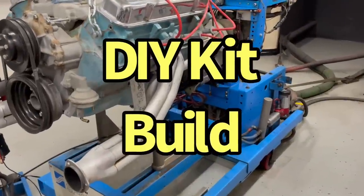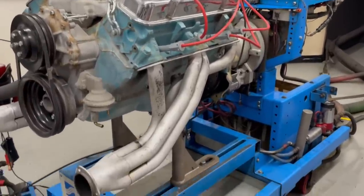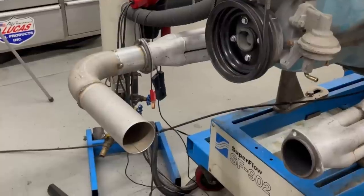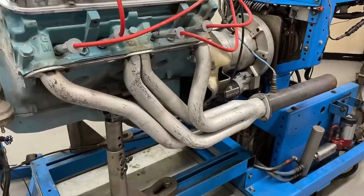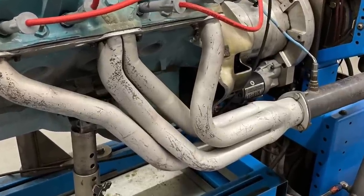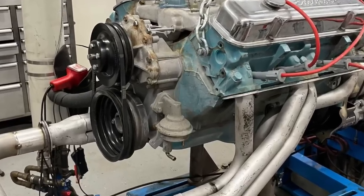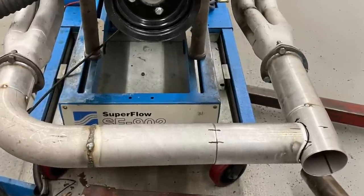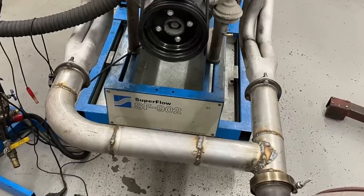Hang on a second — aren't those backwards? Yeah, look what we've got going on over here: turbo kit! DIY. After reversing the headers, we needed to make a Y-pipe. So I grabbed some tubing, three-bolt flanges, turned it 90 degrees, aimed it toward the other side, grabbed the straight section, did a little cutting, did a little welding — and voilà! Instant Y-pipe.